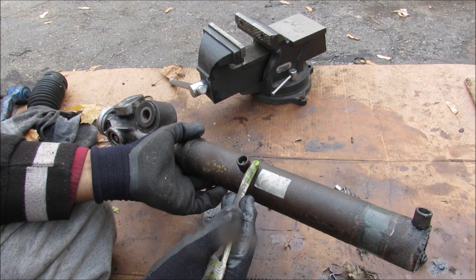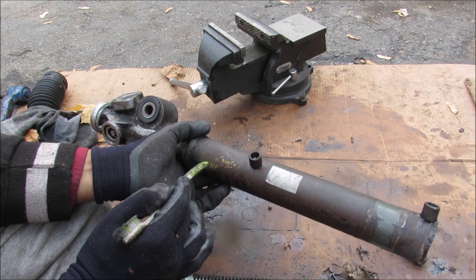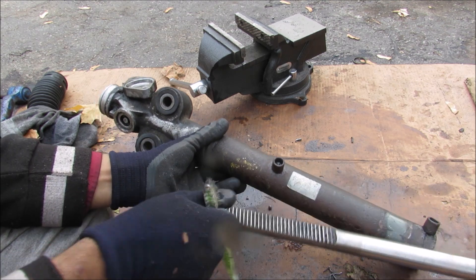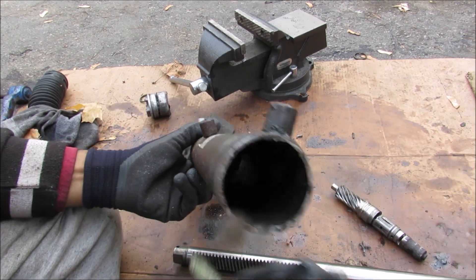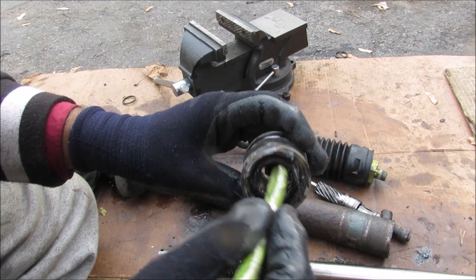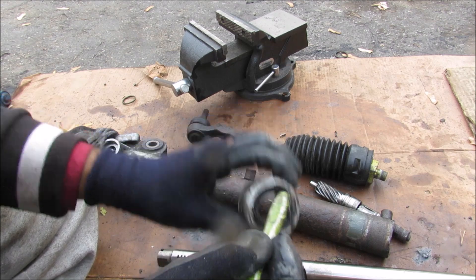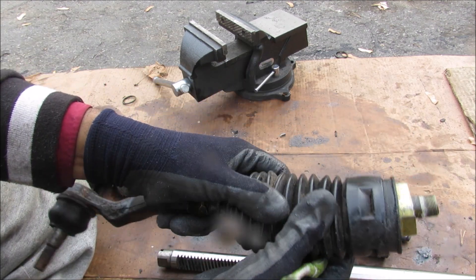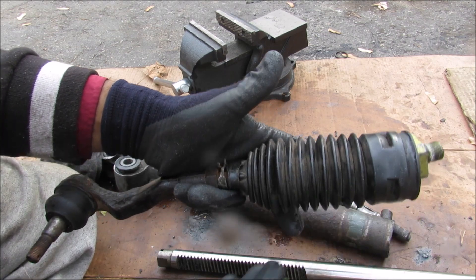The piston operates only between these two ports. Further past that there's a seal that seals off the hydraulic chamber from the chamber that has the gears on the pinion side. When your steering rack is leaking, it's actually the seal on either end of the hydraulic tube that's leaking hydraulic fluid out into the steering boots. That fluid can burn through rubber easily and eat up these boots, causing a leak.